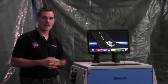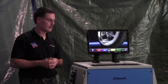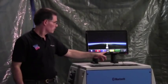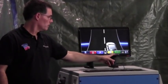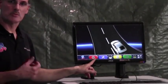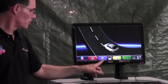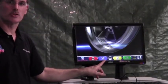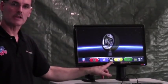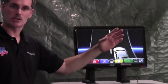The operation and navigation of the 1760 is very similar to the other two aligners. You have on the screen a red, blue, gray center button, yellow, and green keys for navigation. The red button is always going to take you back a screen or stop the current operation. Your yellow and blue keys are typically used in the alignment program for navigation up and down. The gray key is typically a selection key, and the green key is always going to advance you forward.